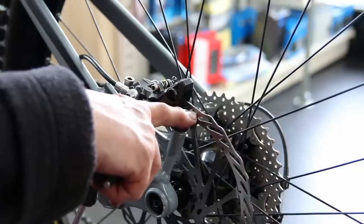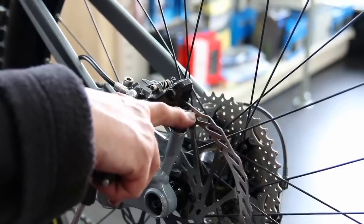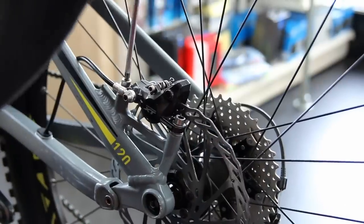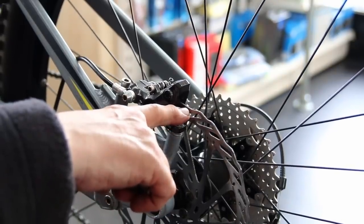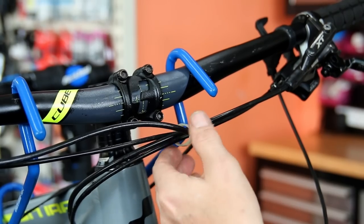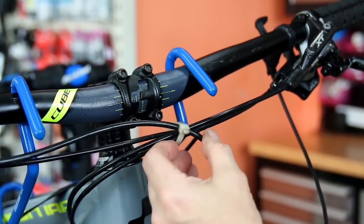But as I mentioned the rear had a little problem - you can see that disc moving as it turns. The disc is actually moving because the caliper is not centralized on the disc, so every time you pull the brakes it's pulling the disc, which will induce squealing. We just loosen those off, spin the wheel, brake it, check it again - and you can see no movement at all now. The wheel is free in the caliper, spinning nicely and braking smoothly.